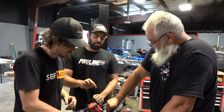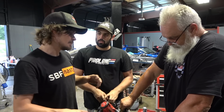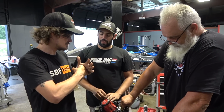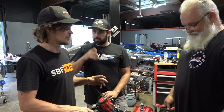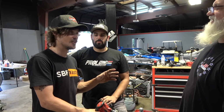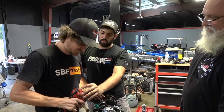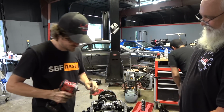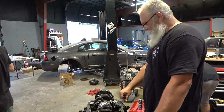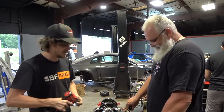If the bearing starts to fail because the oil got messed up, I think it had so much thrust pressure that it got against the bearing, and then all the methanol in there too. You gotta think we're running this thing on like a 90-10 mix of methanol and oil. 90% methanol. We started out with 50 weight oil, and we ended up with 21 weight oil. The amount of oil, it looked like we were draining the fuel tank.